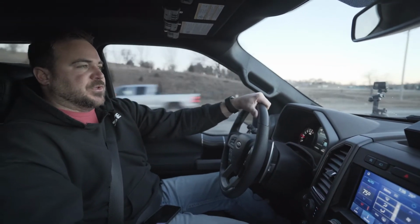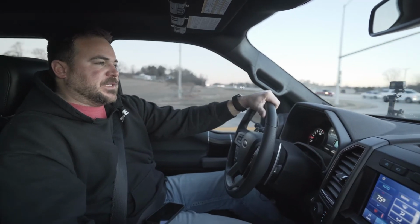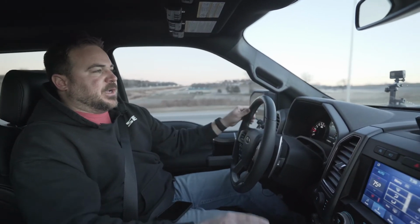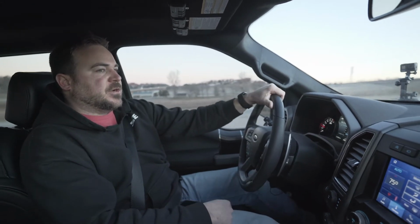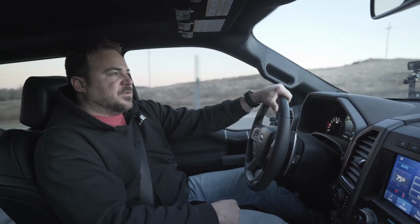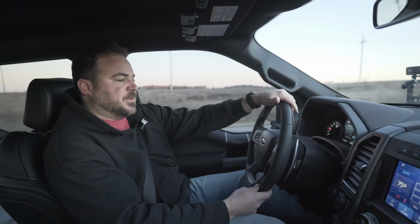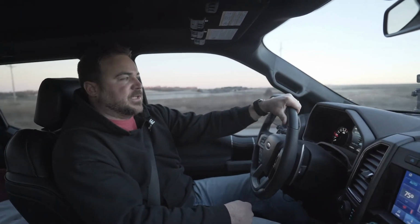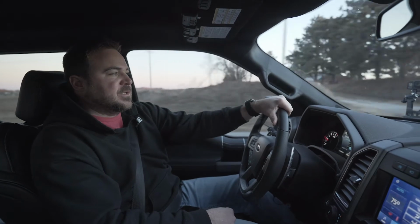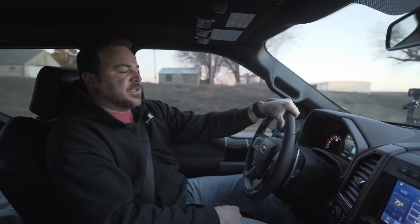And then they went to larger turbos, so there's a lot of understandings inside these newer ECMs with turbo speed and turbo speed control. There isn't a way to measure turbo shaft speed on these twin turbo gas direct injected Ecoboost. There just isn't. So the ECM calculates turbo speed to push these engines a little bit harder while keeping the boost at somewhat sane levels. We have to run our own calculations to make sure that we're not going to blow the turbos up by over speeding them. And normally the overspeed events come from really high torque at a fairly low RPM as the turbo's trying to drive airflow up. But anyways, we came out with a pretty good product.